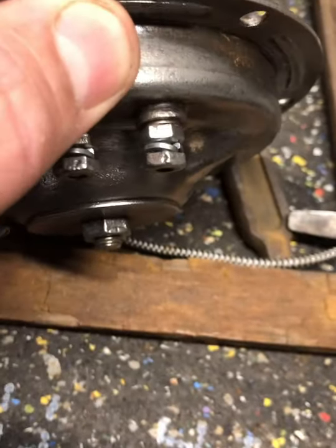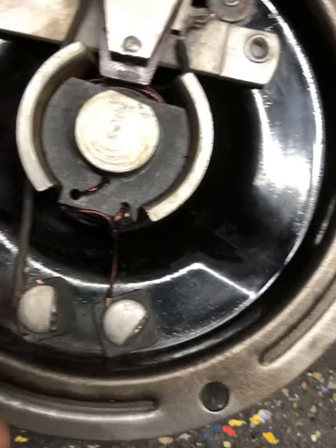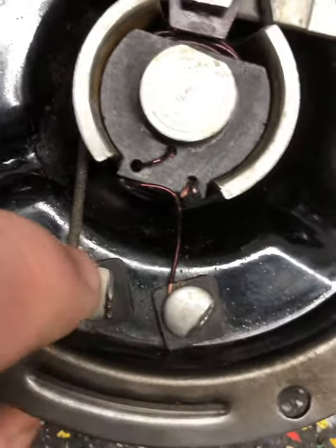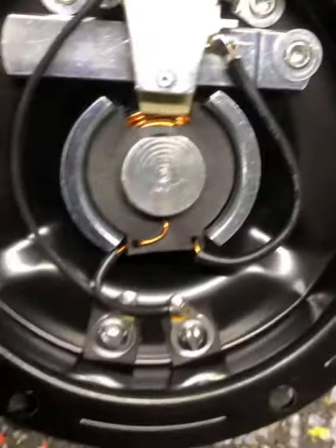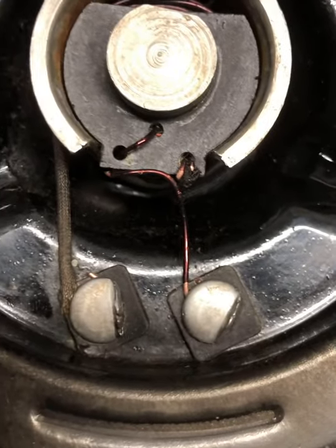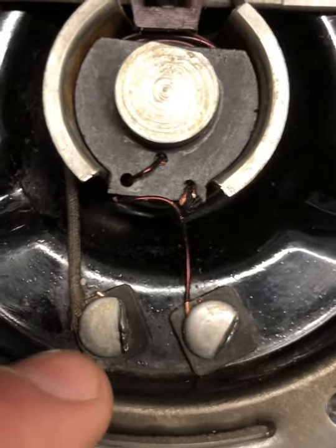The third assembly to put in is this whole piece here, which on the repro would be this piece — riveted in two places. This assembly is basically a sandwich of insulators. It's screwed in and there's absolutely not enough room to get in there without having done this as a separate assembly. Now of interest: this flat-head dome screw has the sides turned up — probably so they could get grip when screwing through the insulators. On the MV Spares version it's done with nuts and bolts.